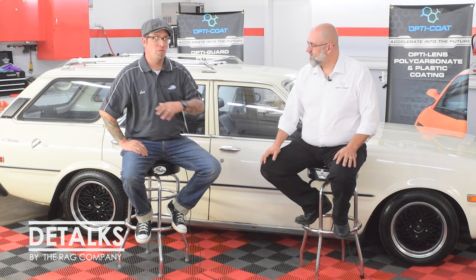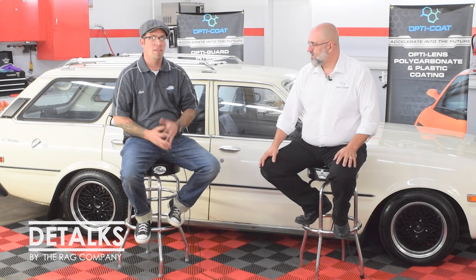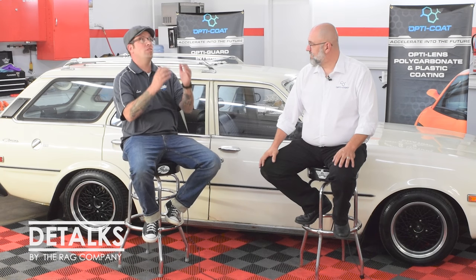So the thermal imaging camera video, that'll be at the end of this. Yep, it's amazing. Seriously, if you haven't ever seen the amount of heat you create just with a bit of pressure, a little bit of pressure. Or the difference between a wool and a foam pad. A lot of guys think that if you hold up a wool pad and a foam pad and ask which one's going to cause the most heat, they instantly point to the wool. And it's the other way around.